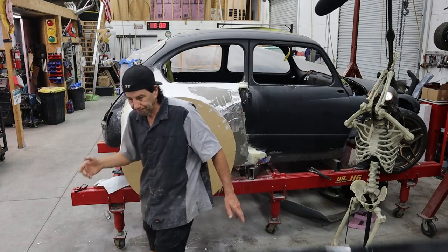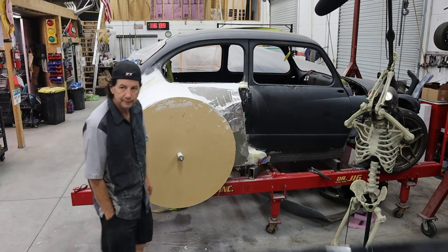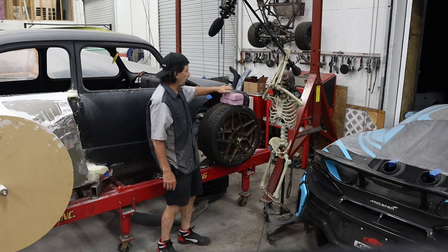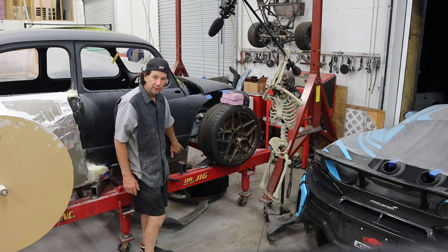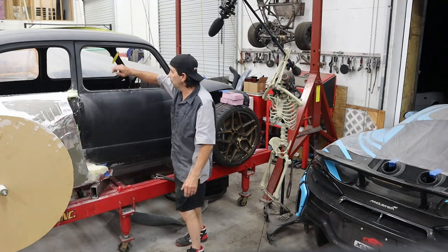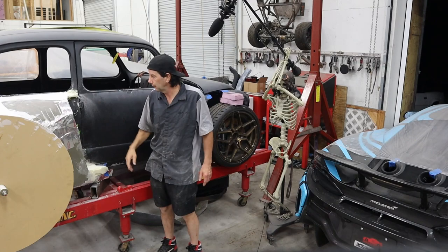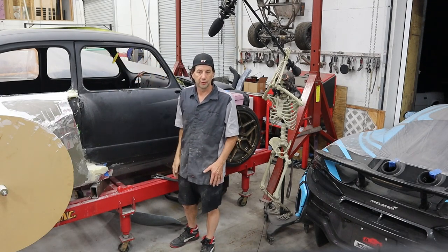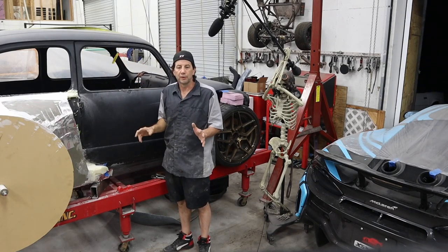The next step really is to check the front out too. The front will look kind of like this — a similar process, with two four-inch blocks. I've got some foam on top of here, and I can see this is going to have a nice little arch right up to the hood line. To get that, I actually raised the front off the rocker by two inches; the back was raised something like four inches overall. So now we know where the hoops need to go because this body is just a shell with literally no structural support. The doors aren't even closing properly right now because the thing is just all over the place. So I'm going to create the back hoop now that I know where this needs to live, the dash hoop, and the main hoops to get the structure on there. Ultimately, the body will actually be mounted — either welded or bonded — to the actual chassis here, so it's going to be more of a unibody car once it's all said and done.